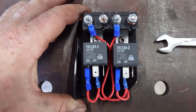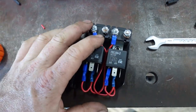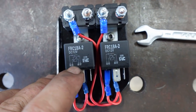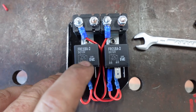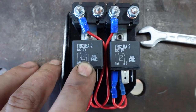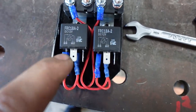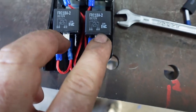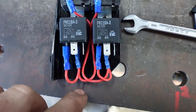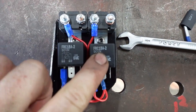I've got it wired up a little bit here. So obviously it's battery in on this side, and then this is the fuse side. So I've got the fuse side going to each relay. And I've just got the power jumped because this is a coil in here, so it needs positive one side, negative the other, so you can switch either side. So I'll switch negative just because there's less to mess around with, and you can pull a positive negative from anywhere. So these two is on the side of the negative terminals, and they will trigger these on, and these two here are the power out. So when I flick the switch on, we'll give earth to these two, which will switch the coil, which will connect these powers, this bottom power to the top, and that'll be my coil and my lights.